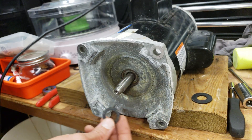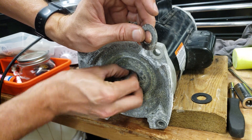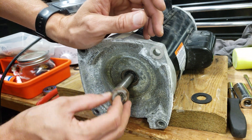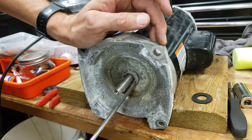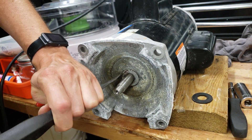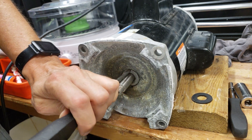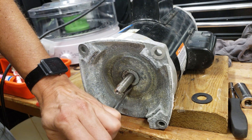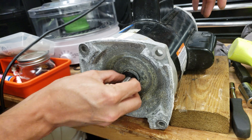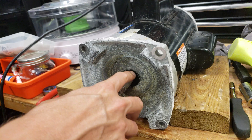There are two seals that go on the shaft whose goal is to try to prevent water from reaching the inside of the motor if it leaks down the shaft. But in this case, it looks like neither one of them worked — there was probably just so much water that went in. There's first one seal, then a washer that gets pressed and hammered in, and another seal on the outside that is supposed to sling water away from the shaft. The purpose of both rubber washers is to sling any water that comes down the shaft away by the rotation of the motor before it can get into the motor. But in this case, there was so much water coming in that it just didn't work.